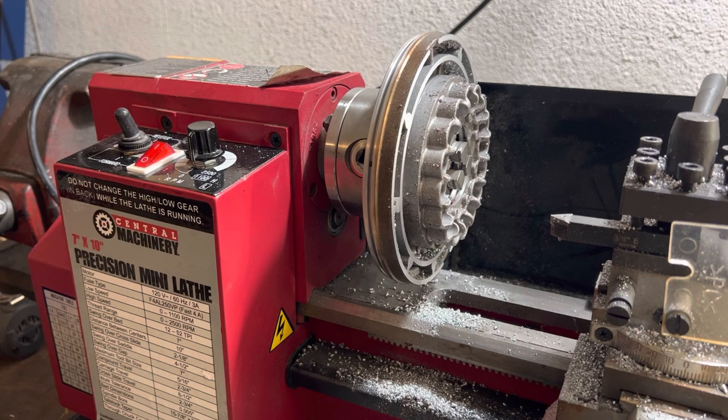That's not something you want to just jump out and cut them all to 600 thousandths. If your goal was to do a heavy duty five clutch stack — that's five clutches and five 90-thousandths or thicker steels — the best combination you can have is thick steel clutch stacks. The more thick steels you can use the better, because they are a better heat sink — they handle the heat better and dissipate it without warping.